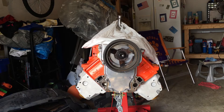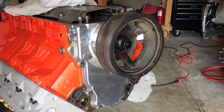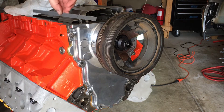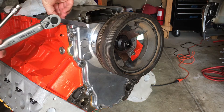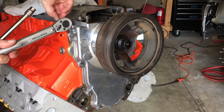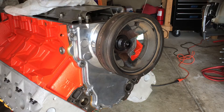Go ahead and get the front cover and the rear cover lined up with the old pan and hopefully get this bottom end closed up. I'll put the front cover on, put a flat edge, and then check the height on both sides to make sure it was within the tolerance, which is .020. On this side I put the feeler gauge in there and I'm .010, and on the other side I'm absolutely flush.